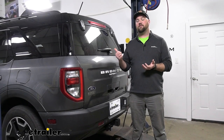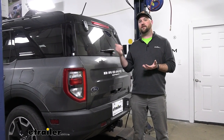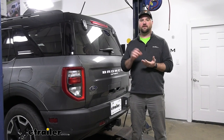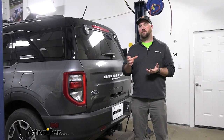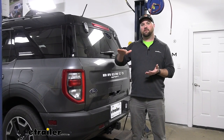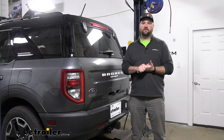This kit is going to be compatible with a lot of different brake controllers. We decided to go with the Redarc Tow Pro Elite for this car because it has a very clean installation. The knob is very small — it's about the size of a dime — and it can be mounted pretty much anywhere because the control module has to be mounted behind the steering column. Most other brake controllers have to be mounted on a certain plane in order to work correctly, but the Redarc Tow Pro Elite can be mounted anywhere that you decide is best fit.